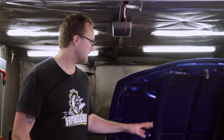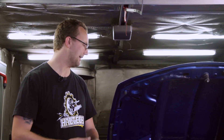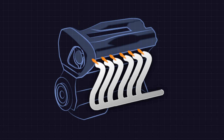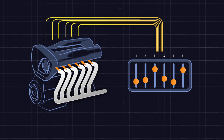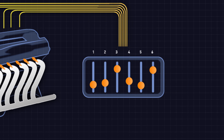This car is also equipped with the Haltech TCA4 boxes. There are two of these boxes, allowing us to have eight individual exhaust gas temperature sensors. Like we've seen in previous episodes, the EGT sensors allow us to measure the exact gas temperature of each cylinder to make sure they're all equal. If each cylinder is not equal you're not at the optimum power level, so the Elite 2500 allows us to look at each individual cylinder and do a 3D map on each one to make sure the engine is running at its optimum.